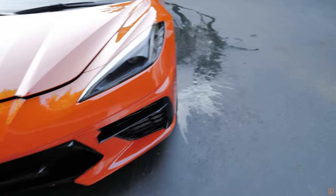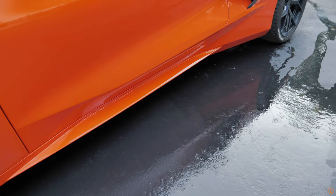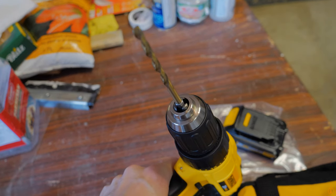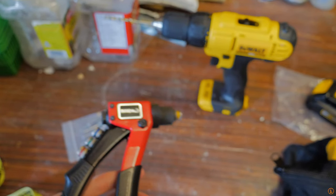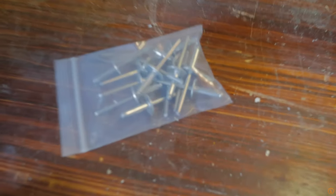Here's the box for the carbon fiber rocker panel extensions — looking beautiful as always, and they already have the hole there. So what we're going to have to do is obviously first of all clean the vehicle. Make sure the rocker panel extensions currently on the car are nice and clean and ready to go. You're going to need a drill with a five millimeter bit, and also a rivet tool, because you're going to get these rivets and you'll need the tool to cut off the end — that's what's going to go on the bottom of the rocker panel extension in the five holes.